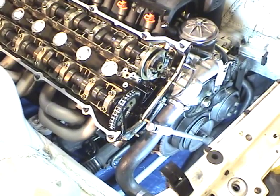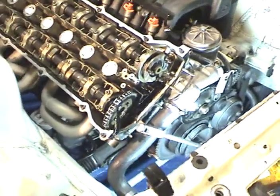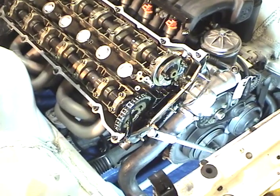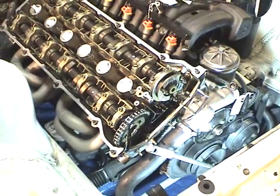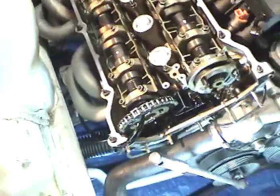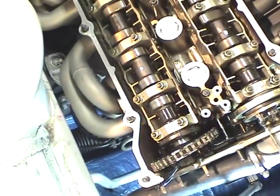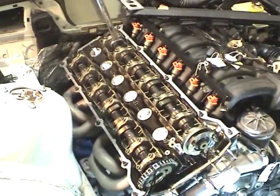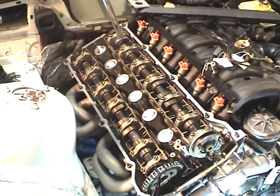We're starting at the point where I've got a wrench on the crankshaft, as you can see, that lets me move the crank off top dead center. Where the wrench is right now moves the pistons down in the cylinder all the way from the valve. As I start turning those cams - because all of the timing chain and everything is removed, including the timing chain on the exhaust valves - they're all free. They can turn any direction, which means those valves could open and close, so you've got to get the pistons away from the top of the cylinder head to make sure you don't bang the valves on the pistons.